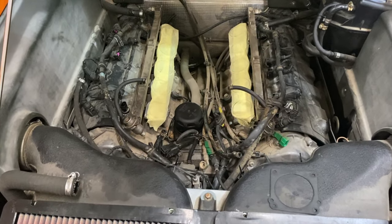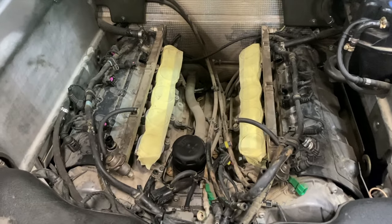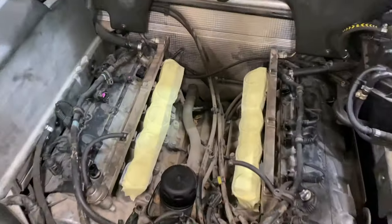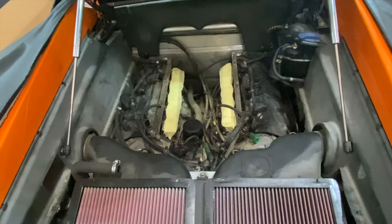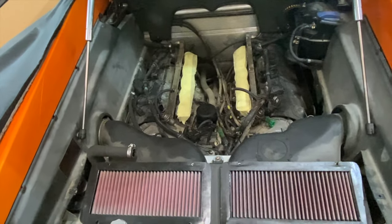So we've taken off the intake manifold covers so that we can access the two engine cooling sensors. If I can zoom in, that is one there at the very front and there's one that side there with the blue connector. So they're the ones that have to be changed and hopefully that will fix my issues when it's hot from the idling, etc. I hope so anyway.